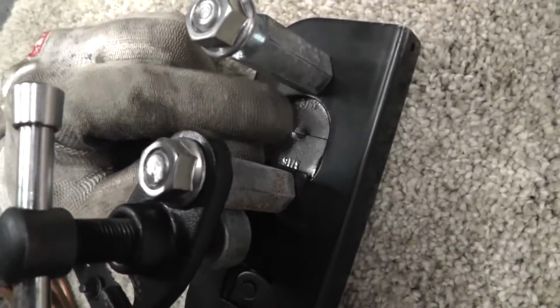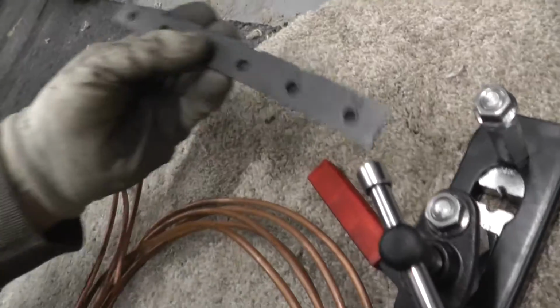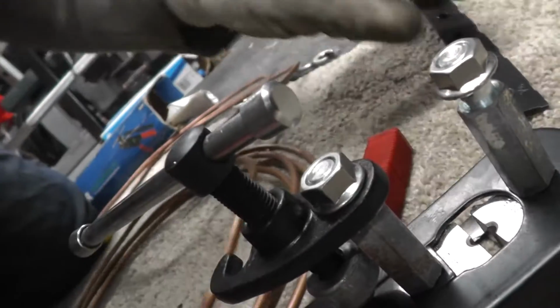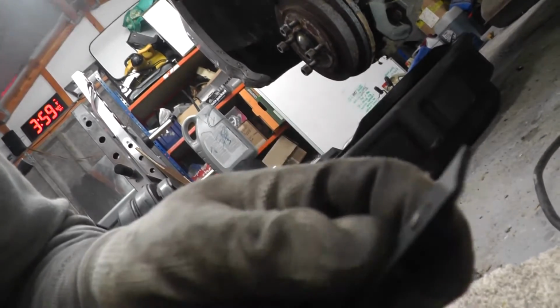So wind that tool out the way. Here you can see it's 3/16 on the upper and lower part of the former tool. If you pull this thing down, then you can just basically place your pipe in there and then use this part of the forming tool the other side. And what that does is that pushes this cone part of the tool down on top of this and makes this shape, which is like a bubble. And then once you've done that, you can use the cone to make the same shape that you've got here. So it's kind of like a double flare you're doing.